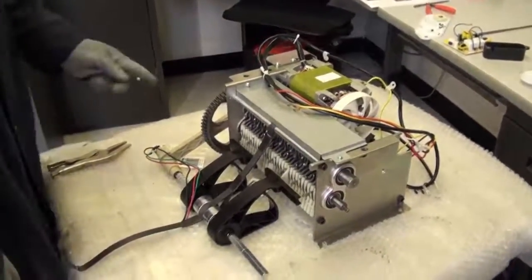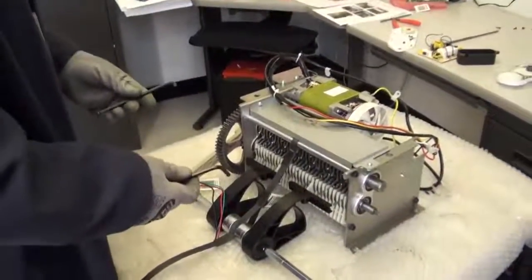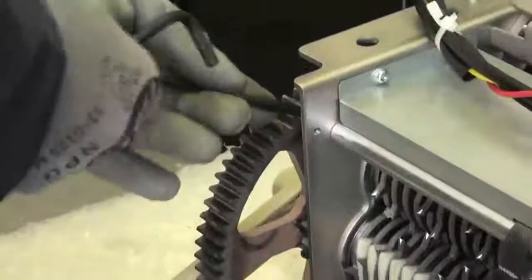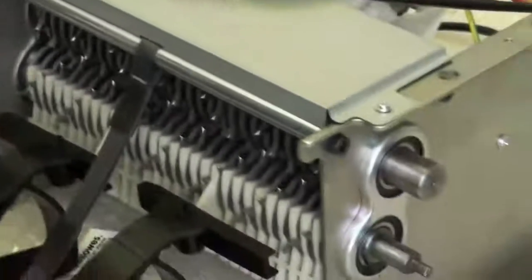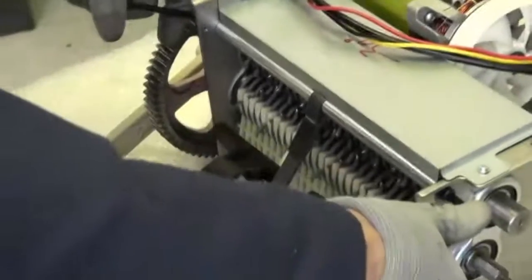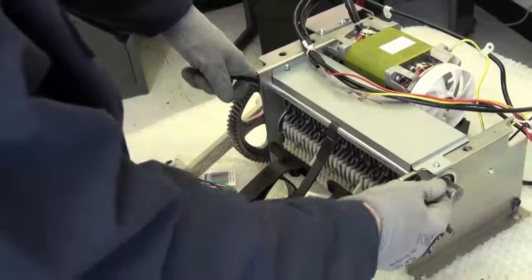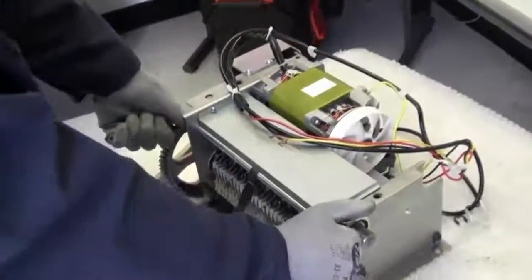To work on the left side, you're going to need your two five millimeter Allen keys. You're going to stick your short end on the left hand side and your normal five millimeter one here on the cutting block bar. As described in the document, there is Loctite, so you need to loosen and retighten your right side and then loosen and retighten to break that Loctite.